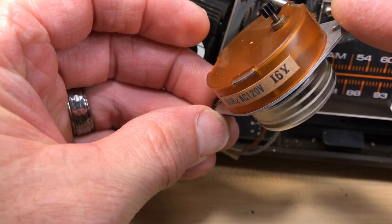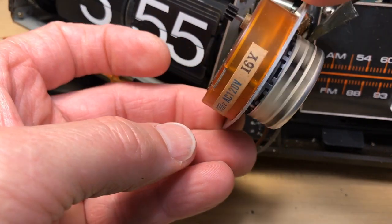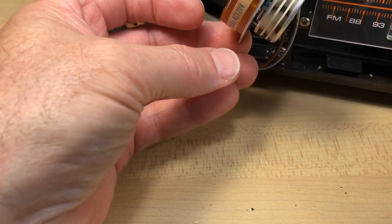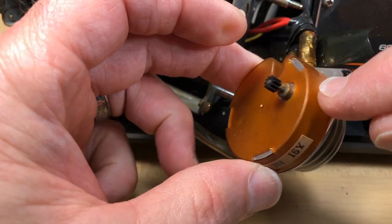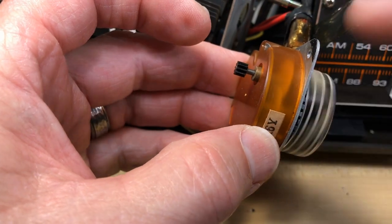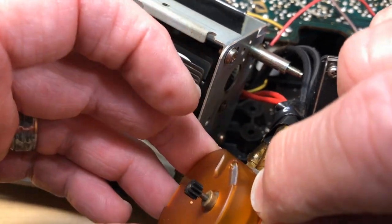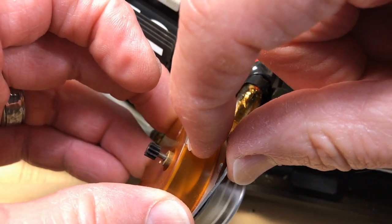See how you can turn that motor in a certain orientation and the sound stops? So all she'd have to do is put her clock radio at about a 45 degree angle — but no, seriously, what I'm going to do is take this off to see if the gears just need to be lubricated. That would be awesome, though not likely — they're probably chewed up. They take this case and push it over the top where it snaps into place, and to restore it you have to pry it off at three different spots, and it's going to crack.